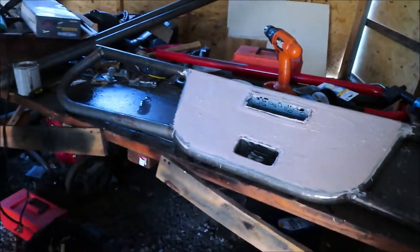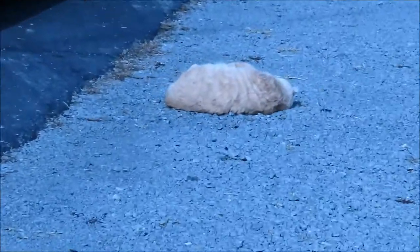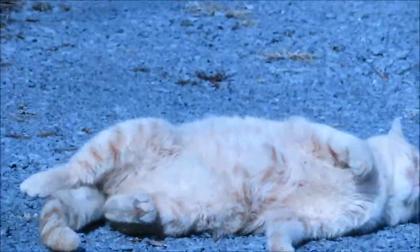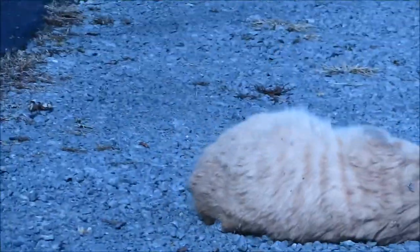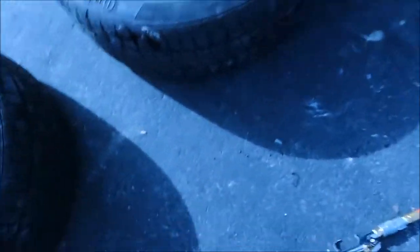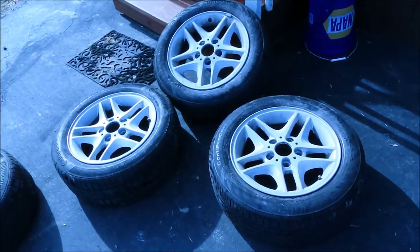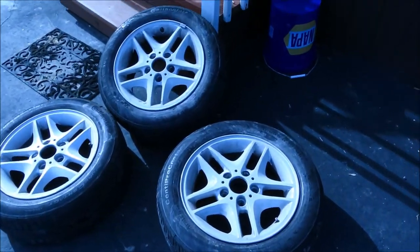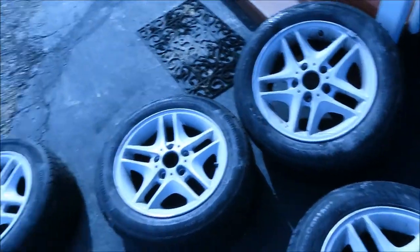It's going to go gloss black — it's actually a BMW color, the same color I'll be spraying today. I just want to go ahead and spray these off with some compressed air to get rid of all that loose dust from sanding. We used 320 grit on these, so they're ready to spray.